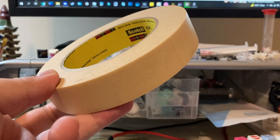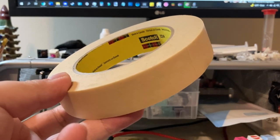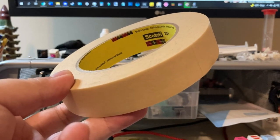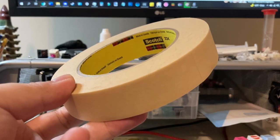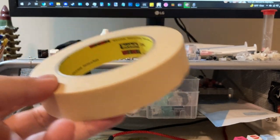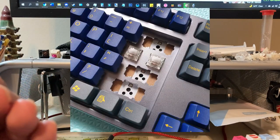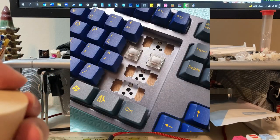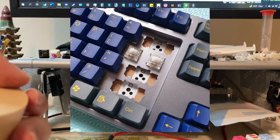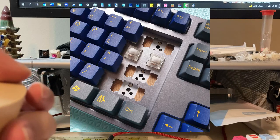Because if you think about it, we have been slapping fabric on pretty much everything. Whether it's fabric or paper or whatnot, or foam. Foam or some sort of insert or third-party helper always seems to be something that people put on their keyboards. So for example, the Band-Aid mod, in which people put strips of Band-Aid where the stabilizers were over the stabilizer holes to dampen the bottom-out sound and also potentially save the PCB a couple of years of use.